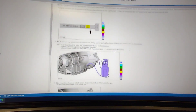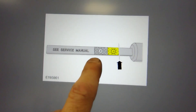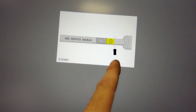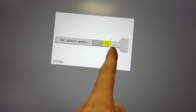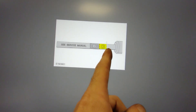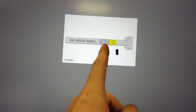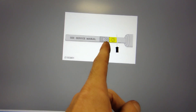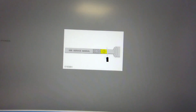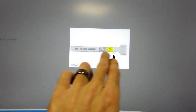Fluid fill. If you look, you have hash marks A and B. Full hot is at the top of hash mark B — that's full hot. So when I got done driving it, it was right around here in A. So I had to add about a quart to it, which brought it up right to the hash mark. So it is good to go now. I just wanted to show you that's the dipstick on this one.